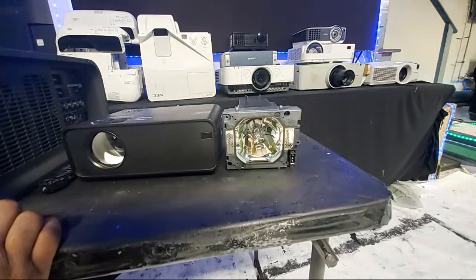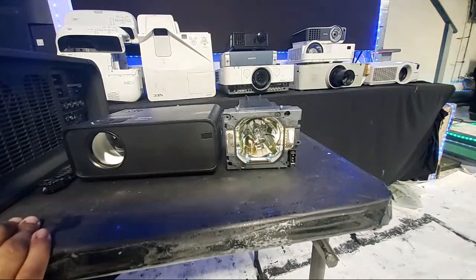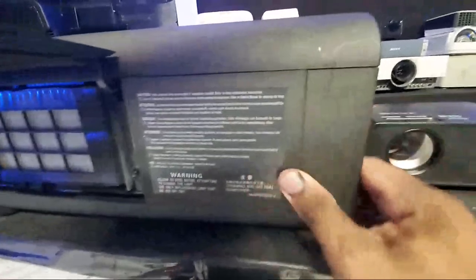I'm just going to order a new one tomorrow, because I was telling them I don't use my projector because something's wrong with it — it cuts off and everything. The guy basically works for Chrissy projectors, and he said you have a discoloration. I said yeah, discoloration on the projector when it goes off. He said your lamp is damaged. So that's what we've got to do — replace the lamp. We're ordering one from Amazon. Amazon has them for $65 to $85.